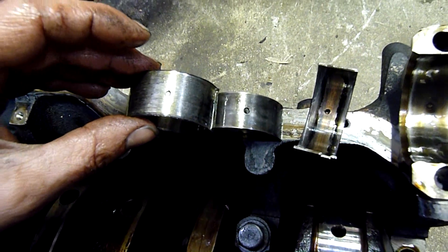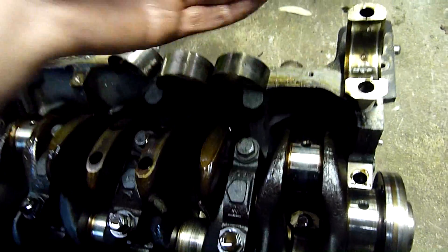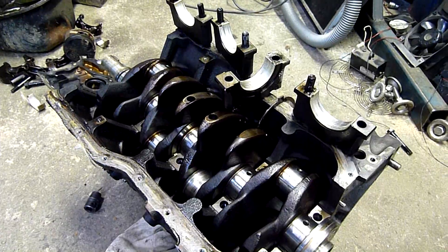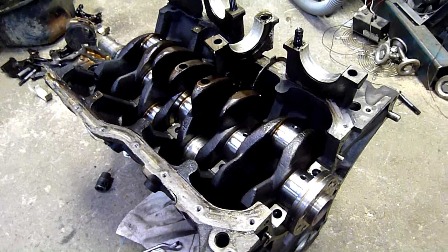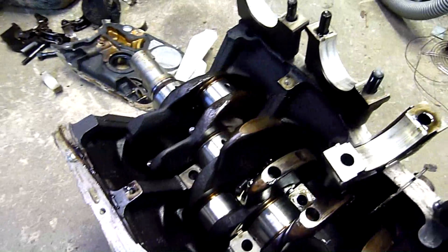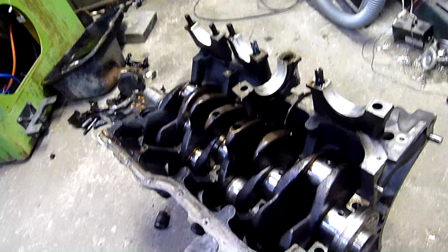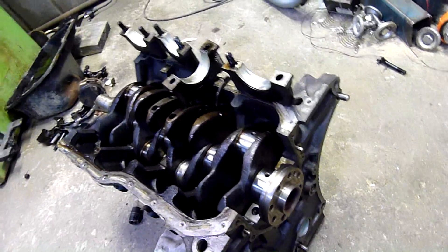It's about four millimeters wider than it's supposed to be - that's impressive. We know how that one died. One last video on the 3SGE. I'm not going to bother keeping any of the bits because it's cheaper and easier to get a complete up-to-date modern BEAMS engine. This one here has been cooked really badly at one point. The carbonized oil on the covers and the pistons, particularly the underside of the skirts, is really bad. So this engine was definitely doomed before Julian bought it.